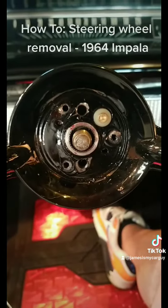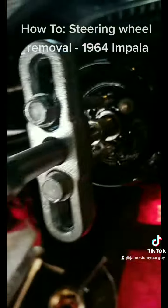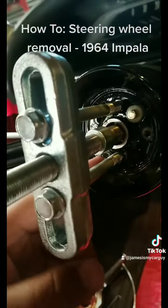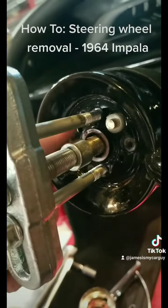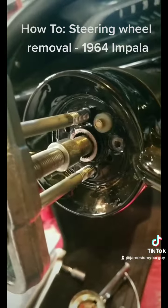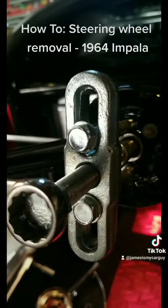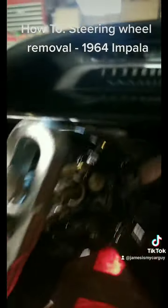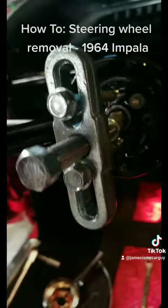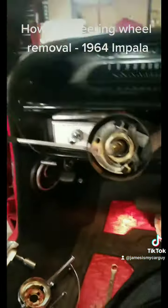Center up the middle screw there and I'll show that in a second. I have the bolts threaded into the steering wheel hub itself, and there's a little spacer that goes on here so you don't grind against the stud. Then you put your wrench on the puller and just tighten it up, and after just a couple good turns that comes right off.